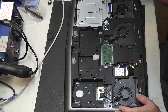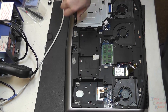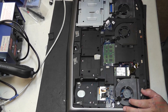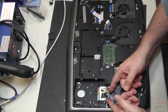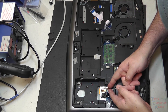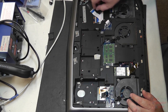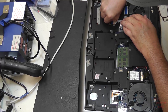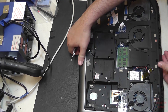We have to remove this optical drive here. There's a plug here that comes with it, then we can remove the optical drive. These two cables here — pull that cable and lift up here. We'll have to pull this ribbon cable here; this is the card reader. Flip that up and pull that out — the ribbon cable comes out.